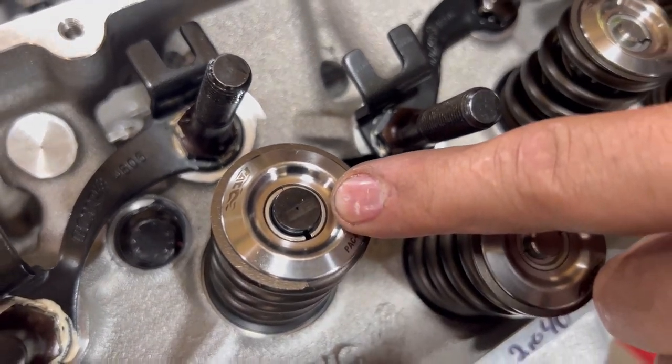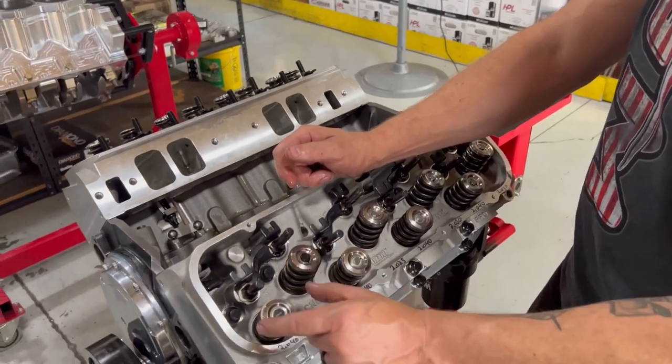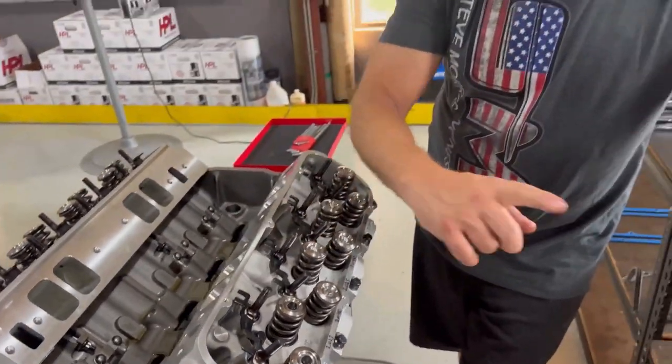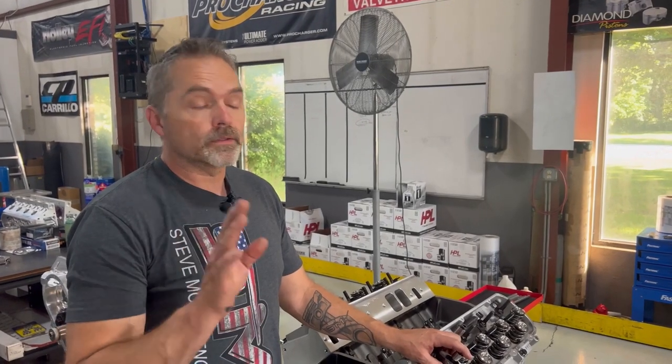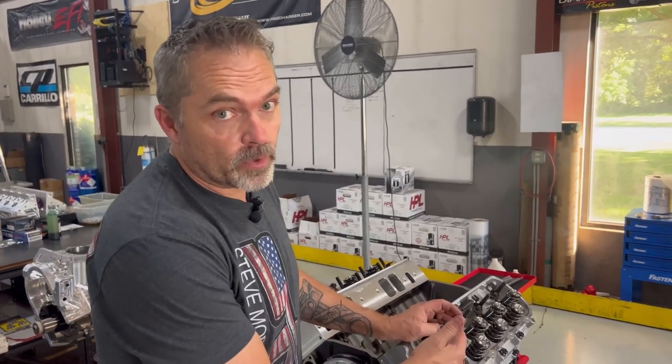But not much more than like 25 thousandths. So super happy with both setups on that. That's a nice looking sweep. Small, short, doesn't have it real wide, and I'll explain all that here in a minute. We got the two rocker arms mocked up on here so you can see how you are supposed to set your rocker arm geometry to determine your push rod length.